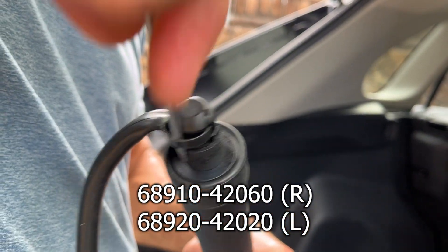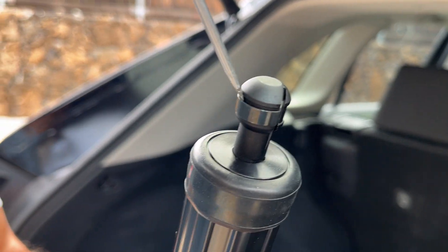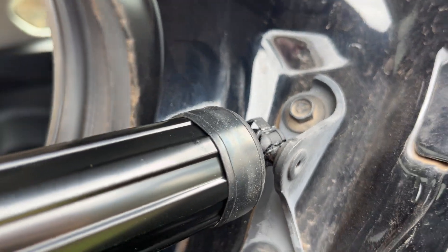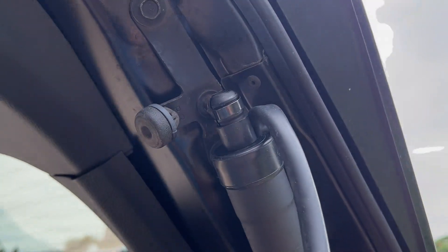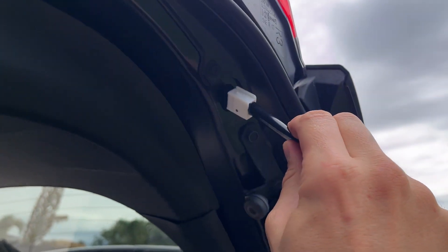Although technically you can shove them on without doing this, it just flows a little better when you do. I decided to change these out with another set of OEM lift supports, but you could change them out with a set of non-powered lift struts and it's probably going to last longer. These only lasted four years, and I don't really suppose they're going to last much longer than that next time around. So it's up to you.